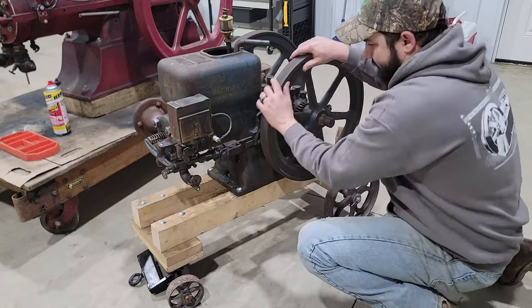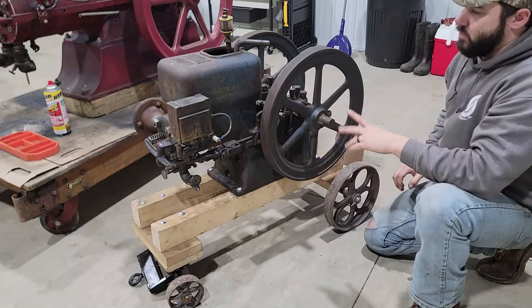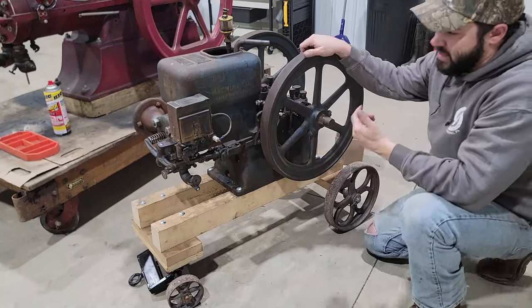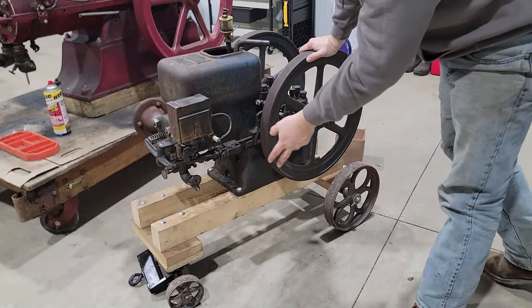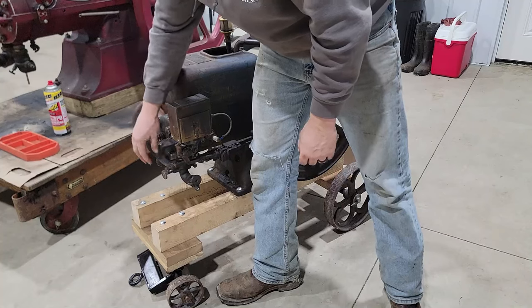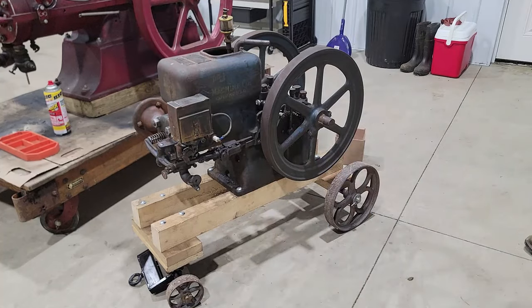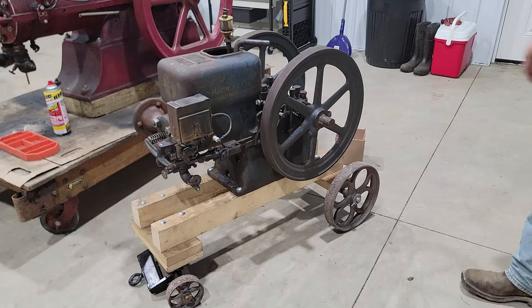And the other thing that we got issues with is the exhaust valve was opening way too early. Now, it makes sense to me. He changed the head on it, and I'm assuming he changed the rocker arm too, and the rocker arm's out of adjustment. And it could be even a tooth off on timing. So I'm gonna go and adjust all that stuff, and that really should be it. As long as that's hot, this thing should run.